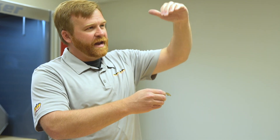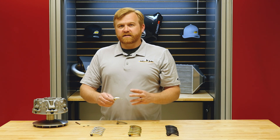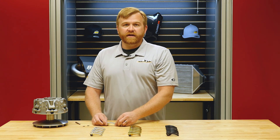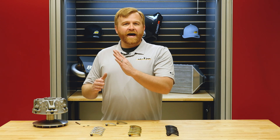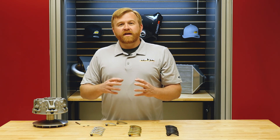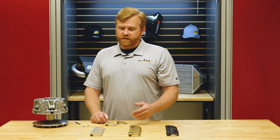You don't want to build a calibration that spikes over peak RPM — spiking up to 8,400 and then settling back to 8,000 sometimes feels great but the acceleration isn't what it really could be. There's also a balance between RPMs and road speed. You want to put the power to the ground at the right time — you don't want to just rev up like you're slipping a clutch. You want to translate RPMs into tire speed on the ground. High RPMs can actually produce a slower result.